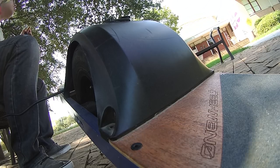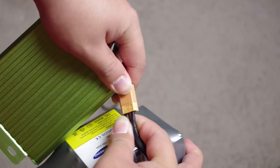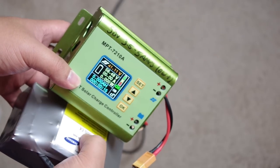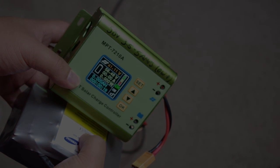This will prevent any damage to the charging port and the controller board of the one wheel. So that's it for the build. All you need to do is make sure your MPPT or solar charger is set to 58 volts and between 3 to 5 amps for charging. Once that is set and your one wheel is plugged in, hit OK on the solar charger and it should start charging your one wheel. All right, Daniel, back to you.